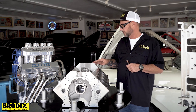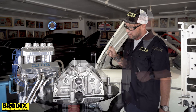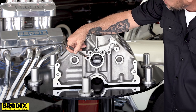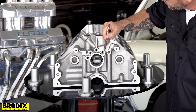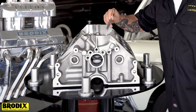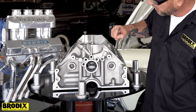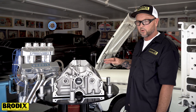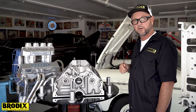We'll show you what the back of the block looks like. With the additional main oil galley line right here, which feeds everything, and this line turned into the dry sump scavenge, you will see a few more ports back here, but this does allow us to pull right out of the very bottom corner back here. This is what the open bell looks like. We've also slickened up the sides of the block — we've gotten rid of the oil filter pad on the sides, so you're able to run an engine heater over there.